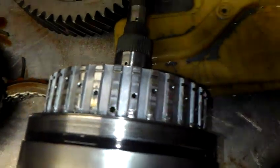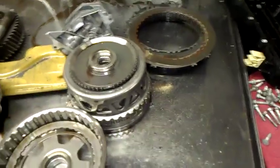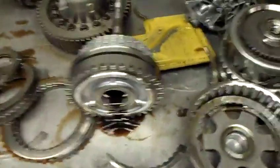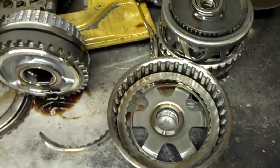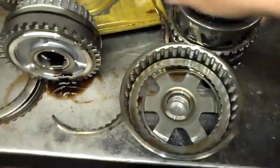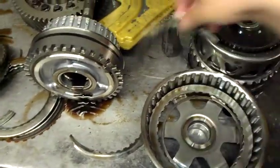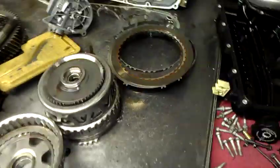The drum is damaged a little bit — you can see where the wavy plate rides — so this drum needs to be replaced anyway. So there we have it: two 6T75E units — one with the failed transmission control module pressure switches, and the other with the typical three-five reverse wavy plate failure. You will see this wavy plate issue on almost every single unit that comes in.